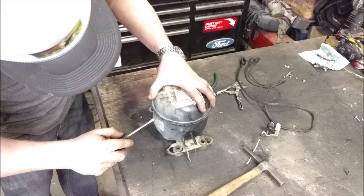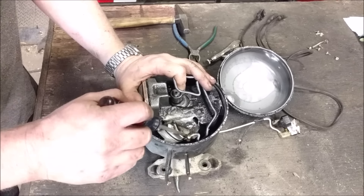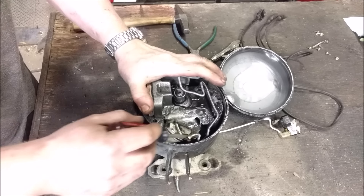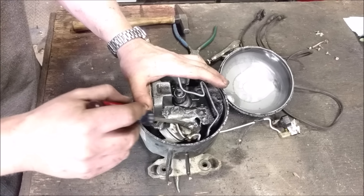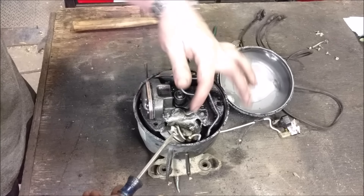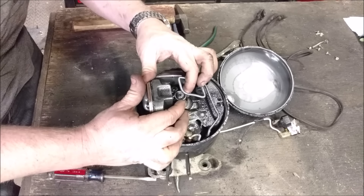It's a pump, just like an air compressor — it pumps, but it pumps gas. You have an air intake right here where it pulls in the refrigerant in a gas form, and it's plastic. But you can see it's all melted around — it got way too hot and just melted this, and more than likely pinched off the airflow.